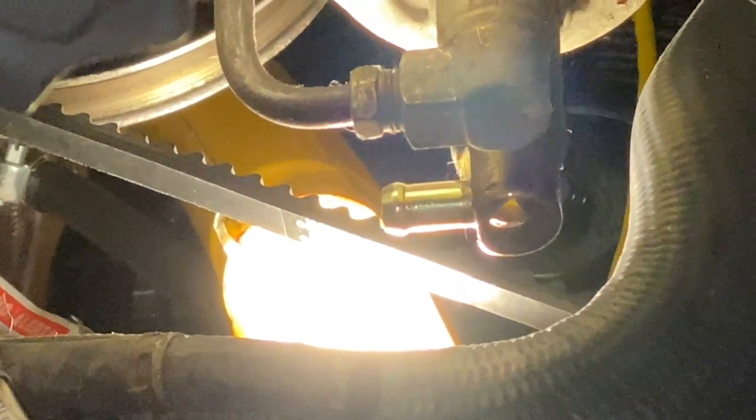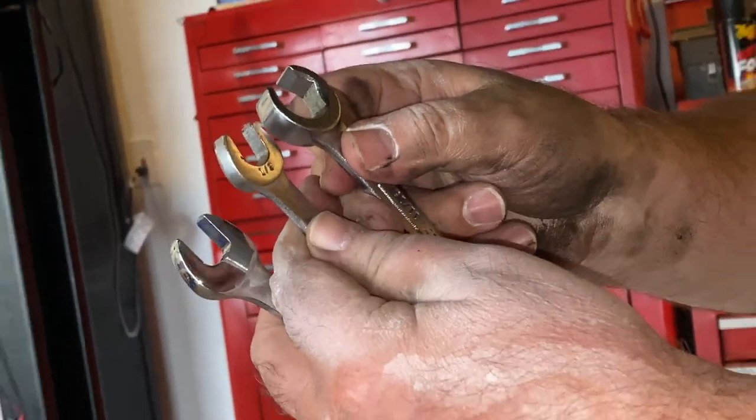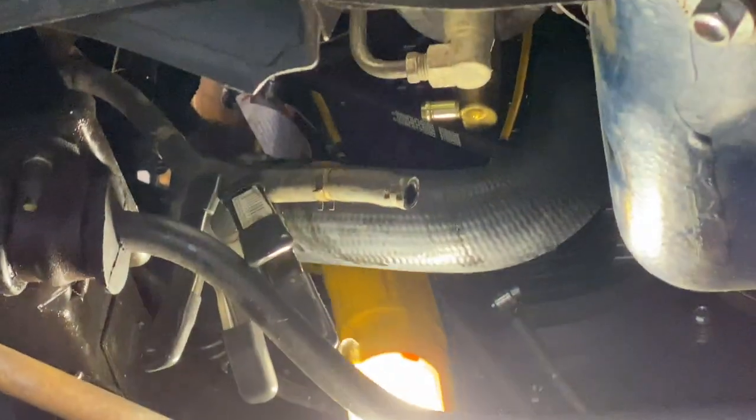One wrench is used against a hex nut on the fuel pump itself, and the other is for the flare nut. We should be using a flare nut wrench, which has five sides instead of only two or three sides like an open-end wrench. The problem is I need a half-inch flare nut wrench and I can't find mine — it's missing. So I'm going to go ahead and use an open-end wrench, which will work fine as long as it's not too tight. If it's too tight, this could round off the nut corners. If that's the case, I'll stop recording and go out to a parts store and buy a flare nut wrench.